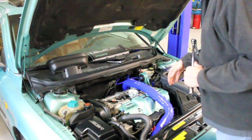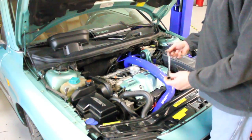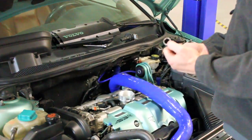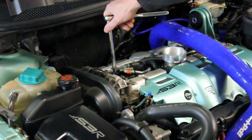It's safest if you don't have a high degree of confidence to just do these one at a time — that way you can't possibly mix up the wiring. To pull out spark plugs you will need an extension and a socket specifically for the job. It's best if you have one that has a rubber plug in it or a magnet so that you don't drop the plug back down the hole as you're removing it. It is quite a ways down there.